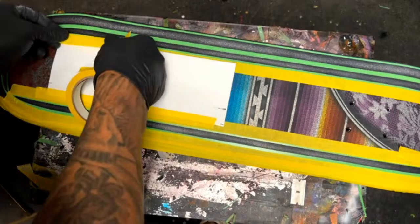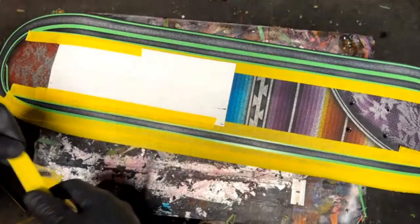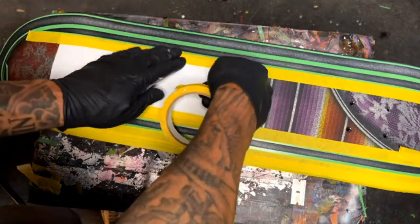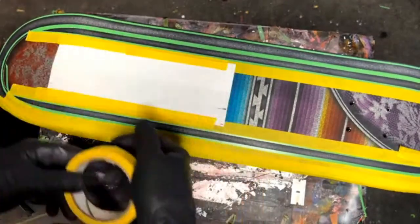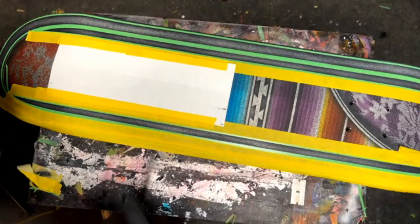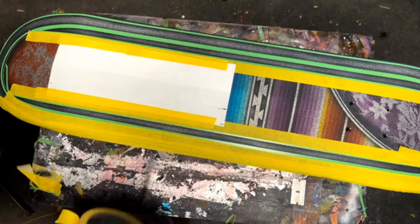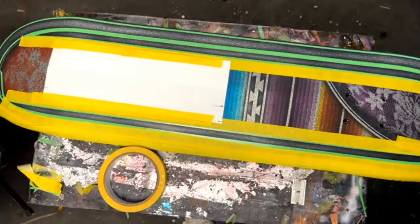Speaking of, good question. How many coats of clear do you normally use over flakes? And what's the most you've done? Over flake alone, you need a minimum of 4 coats, and then you can sand it down. Usually you can start there, and then do another session. So 4, 5, 6. I would say 3 sessions, 12 to 14 coats total would be a normal paint job for me. But it could be more than that.